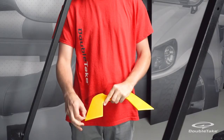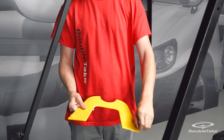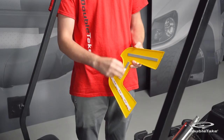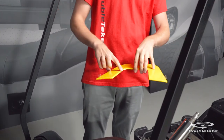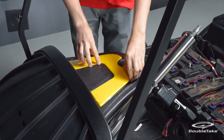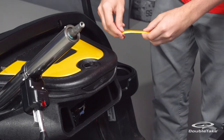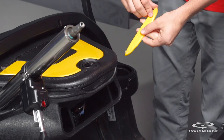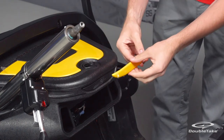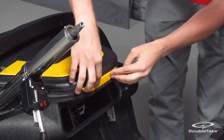Finally, install all the color trim. Partially peel back the protective film from the edges, which prevents scratches during the installation. Remove all double-sided tape before adhering the color trim and position on the dash lid, fascia, and cup holders.